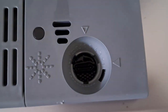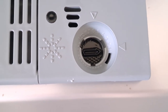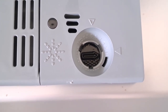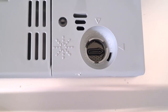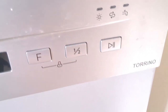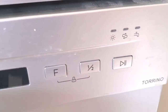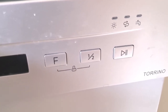There's no headache of relying on any maid and you can wash your dishes as per your convenience and time. This is the rinse aid compartment — we can set the rinse aid usage from level one to six; we are currently using it on level one. The job of rinse aid is to give a shine to the utensils. If the rinse aid needs refilling, the left side light turns on; if salt is finished, the center light turns on; and the third light indicates no water supply.